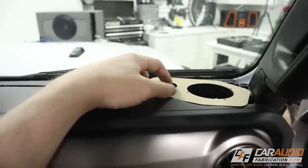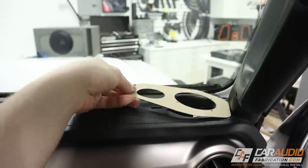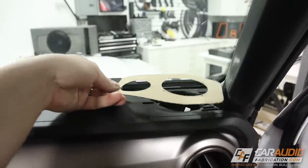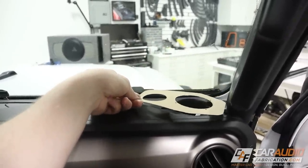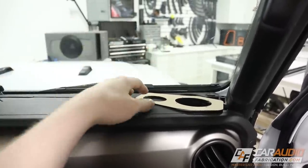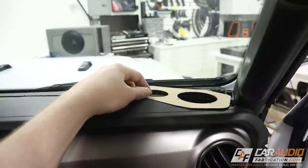What I tested out is laying the piece down flat like this. I know I'll need to change the shape a bit, but I do like this orientation. I can actually space this surface up a little to give myself enough clearance for the tweeter, and since the hole lines up with the existing speaker location below the mid, I'll have plenty of clearance there. If I sit something like this, it doesn't block out hardly any of the windshield at all — that's good. And another advantage: because of the steep windshield angle, I can easily reflect the sound off the hard windshield surface and it will still sound great in this orientation, much like the factory speaker.